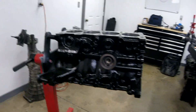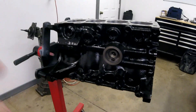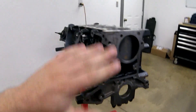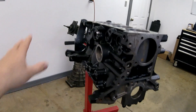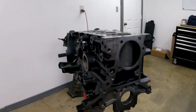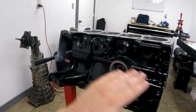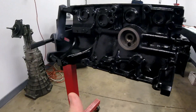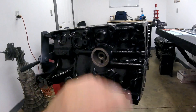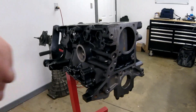When I get it, it's got lots of machining oil on it. He does a hot tank cleaning before he cuts it so all the grime and dirt is gone, but I do two or three more cleanings when I get it back. First pass: I clean it with Gunk Original — my favorite cleaner — spray the whole thing down, wash it off with a hose, put more Gunk on it, wash it again, then spray it off with brake cleaner, which dries quick and doesn't leave residual liquid behind to rust. Then we masked off the block and painted it using a high-temp engine primer and a high-temp engine paint, and let it dry for a couple of days before going back to it.